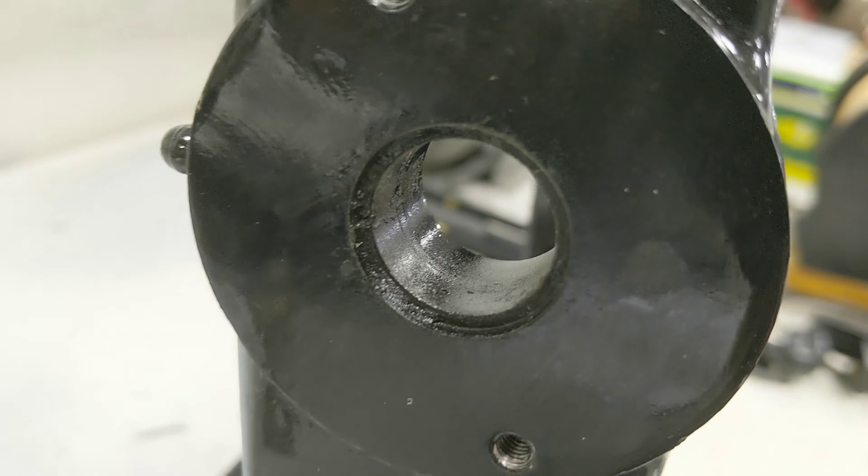More as an option for viewers — this is what we're talking about. If one of those end pins is wallowed out on one side, they go in, weld it, and remachine it. Same thing for the top — that's where mine was screwed up, walled out. Here it is remachined and redone. They do more Bravo stuff than Alpha stuff, but mine was damaged — not all the holes were damaged, so it wasn't too bad to get fixed up.